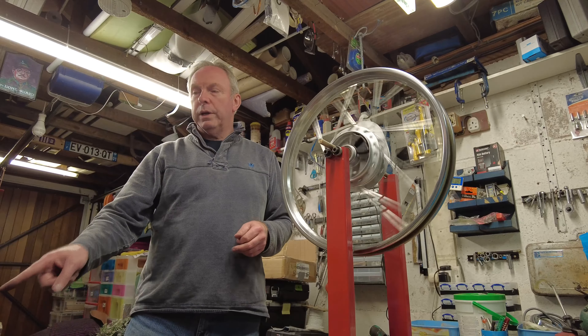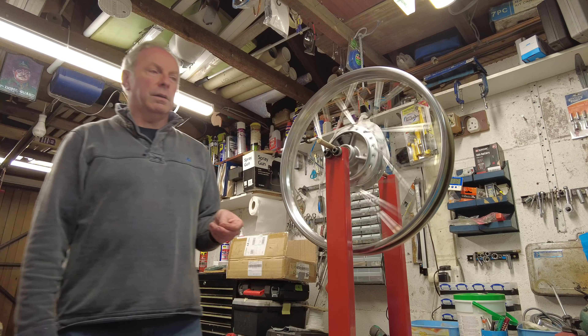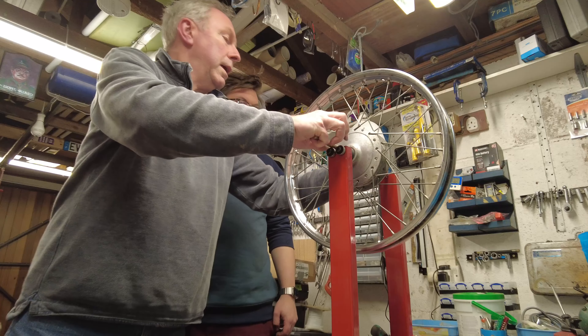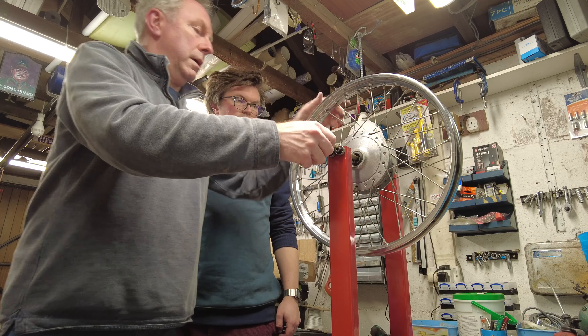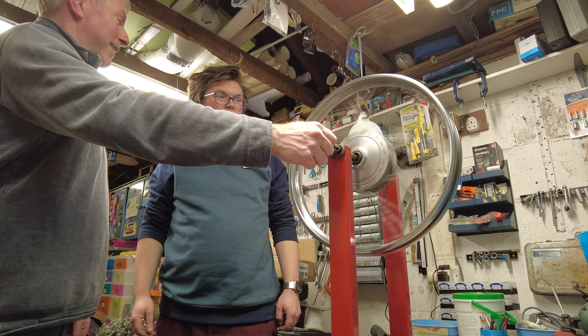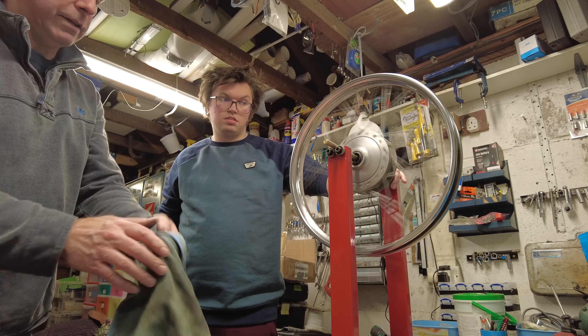To be honest, they're probably fine — they're not that good even on a new one. What isn't good though is the front wheel: the spokes were loose and rattling. I've tightened them up slightly but they were really quite loose, and I don't know if I can pull that back. But you're talking about a bike here that's doing 30 miles an hour, not a 90 mile an hour motorway cruiser, so you're not going to get bad wobble just because the wheels are a little bit out.